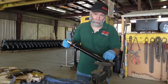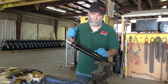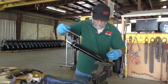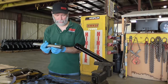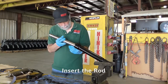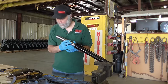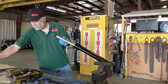Make sure that you have a plug removed where this hose would go in, just so you're not building up air pressure as you're trying to reassemble it. We'll reinsert the rod, and you'll notice with that grease on those split rings, they'll stay in place for us. We'll get that inserted.